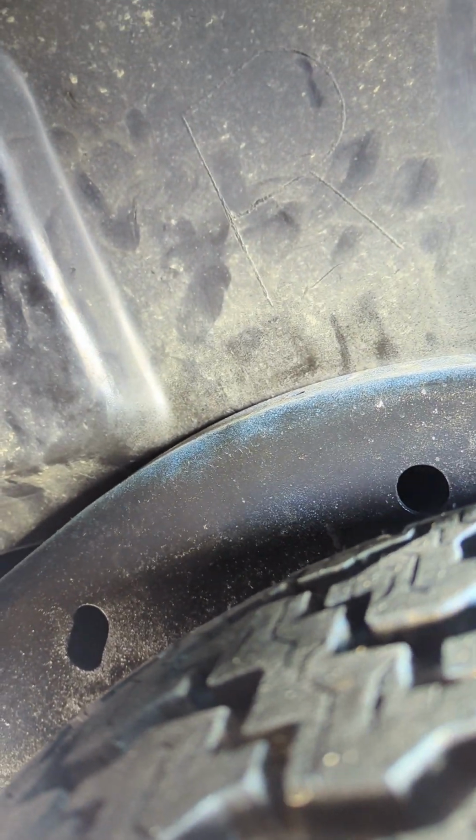Now, you cannot get to this middle Phillips head screw to remove it or install it with the body on. So we removed these when the bodies were off, and there is no middle screw there now because we just recently reinstalled these and we can't get to it. Now on the back here, you've got two 10mm bolts, and then you've got these 3 body clips that have the center that you pull out, and then the body clip pops out.